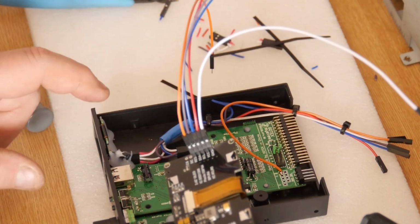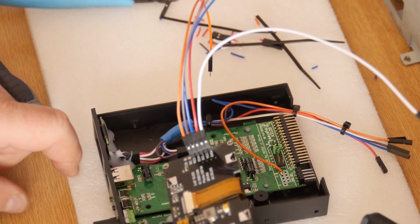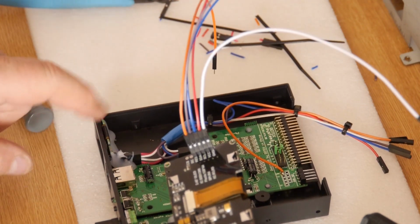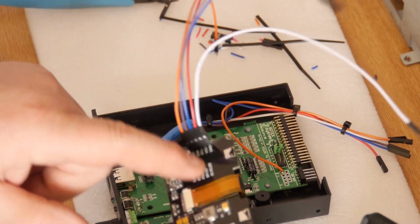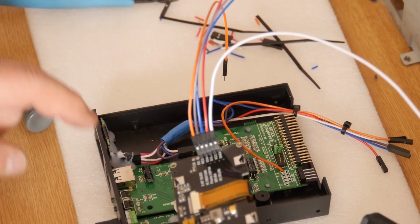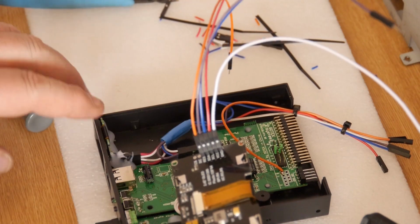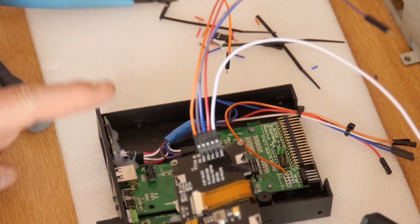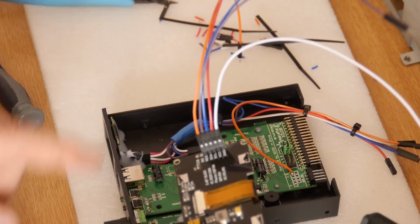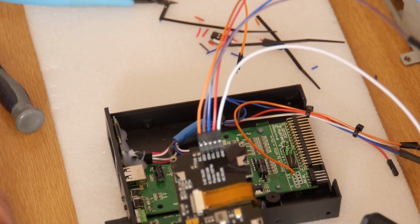If you've got a smaller display in there, which we'll explain later, in the initialization file for the Gotek, we can tell from there. But if the two displays don't match, you can't have this one running in parallel with that one. What you'll have to do is just run it from there to this display and ignore that display. But if they match, so if the resolution of this one is the same as the resolution of this one, you can run them in parallel. So this one will work at the same time as this one.